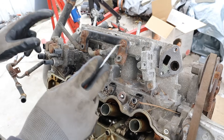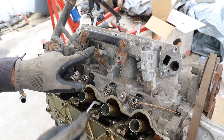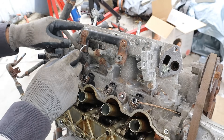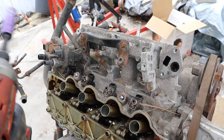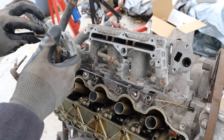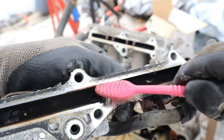There's no dedicated exhaust gas recirculation cooler on here. They just pump coolant into this part of the intake, so the exhaust gases pass by there and get cooled off. Kind of a cheaper solution, but it works and it doesn't leak. I'm going to remove these tens - that's where all the exhaust gases run, and just as I said there's a lot of soot built up inside, which tends to clog these things up.